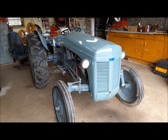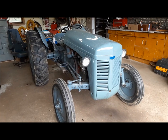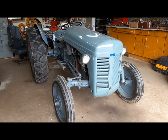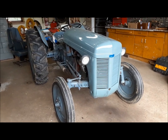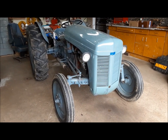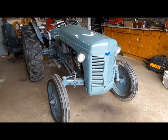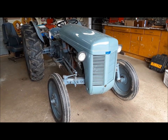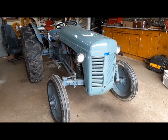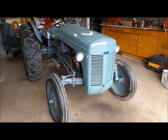Racing season is kind of winding down, so while the tractors are starting to break again, let's have a look at what we got here. This here is a 1949 Ferguson TE20. It's a little different than my TEA20. Basically, the engine is different. This one's got a Z120 Continental, and mine's got a Standard Motor Corp Vanguard engine in it. Aside from that, pretty much the same machine.